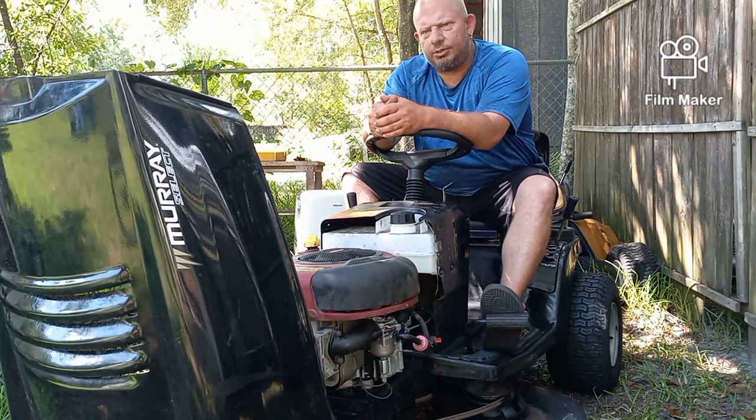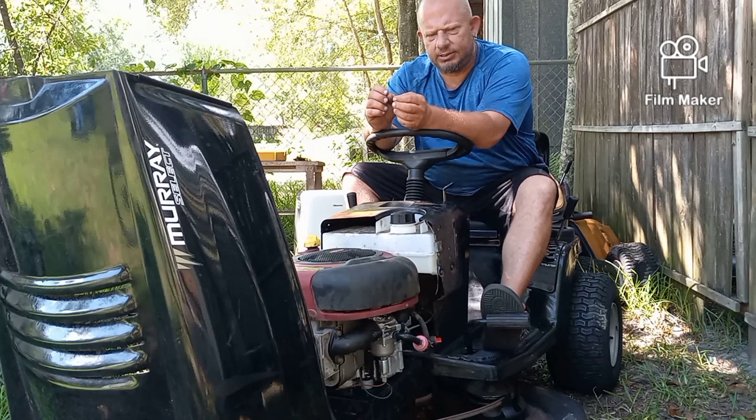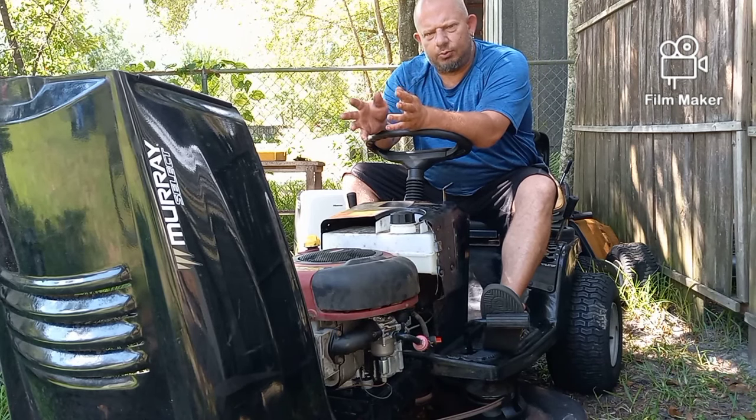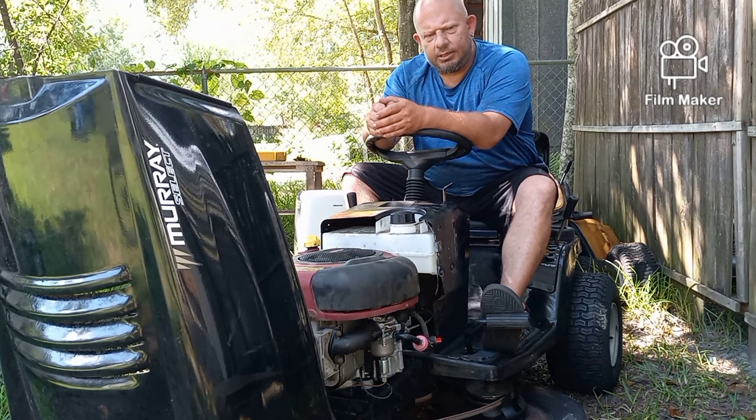I tell people if you're working on your own stuff, every spring when you do your spring cleaning — when you change the oil, check your spark plugs, clean your carburetors, give it a good once-over tune-up — you should always pop the valve cover and check to make sure your valves are adjusted correctly.